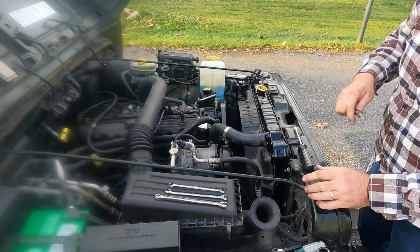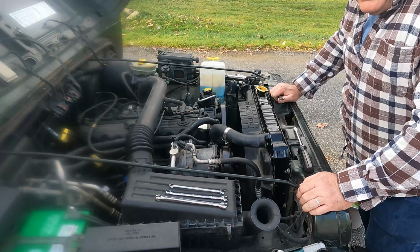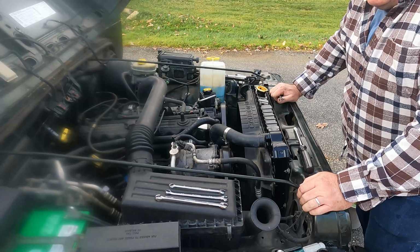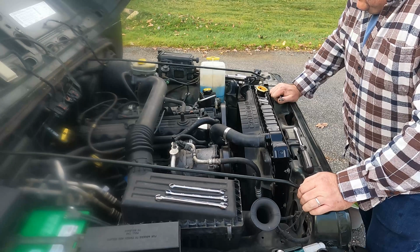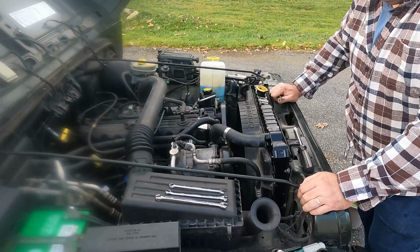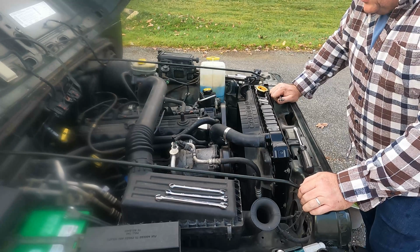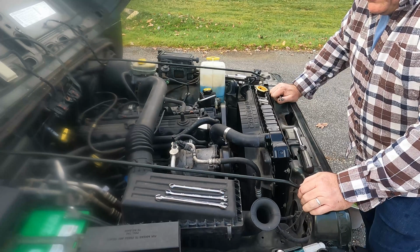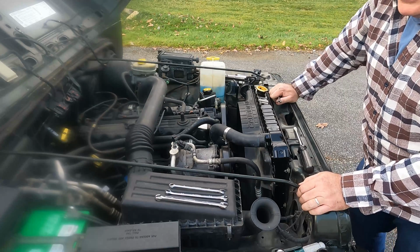I see a lot of people online saying, oh, it didn't cool, I put it in and I'm on the highway and it doesn't cool the Jeep down at all as far as the coolant temperature and everything like that. You probably have a big air bubble in there, and air doesn't cool very well. So chances are that's what was going on with those particular reviews. I don't know for sure. It's just an educated guess, I guess.